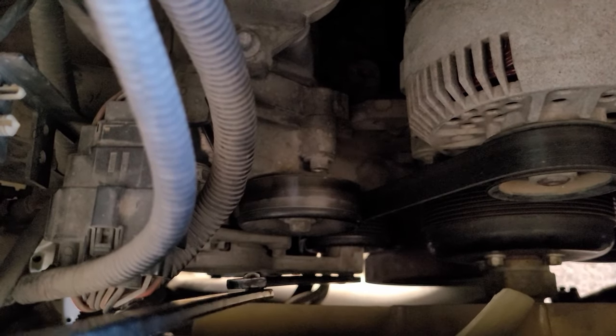Be gentle with all these plugs because you'll just increase your repair time enormously if you go breaking this stuff. The clutch harness just has a little button. Got that plug off. Looks like there's a zip tie on the refrigerant line holding that wire that went to our knock sensor — let's cut that, so the harness is free. Pushing up and forward on the compressor — we can see the bolt right here that holds the refrigerant lines on. Now we have access to that bolt, we can release the refrigerant lines and pull the compressor straight out the top.